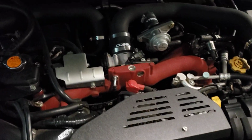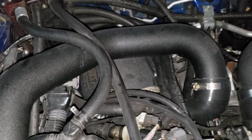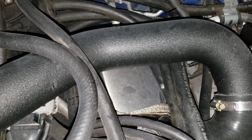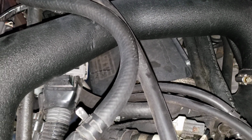And another thing I got was the turbo blanket, hopefully to get rid of some of that heat from the summer. Here's a video, I got the light on for you. You can see it. I got it stuffed underneath the Grimspeed heat shield I have. And yeah, I noticed with the heat shield off, I can leave my hand on the turbo blanket while the car is running or after driving it. But when I put the heat shield over the turbo blanket, it's kind of weird. The heat shield, I can't put my hand on it. It burns.